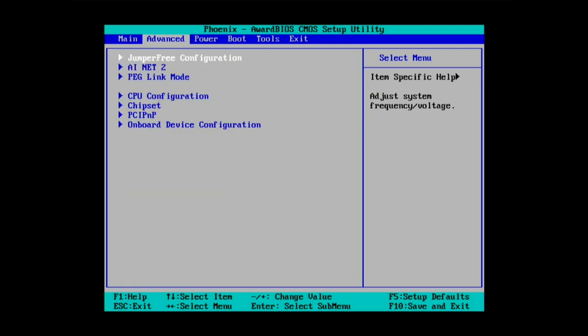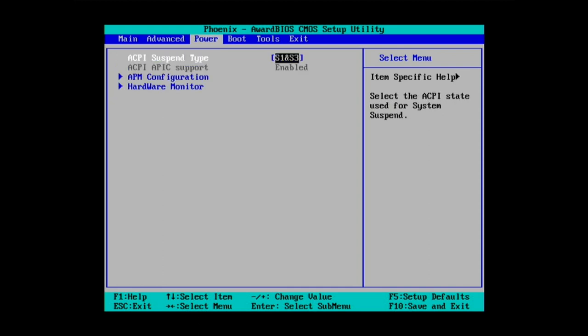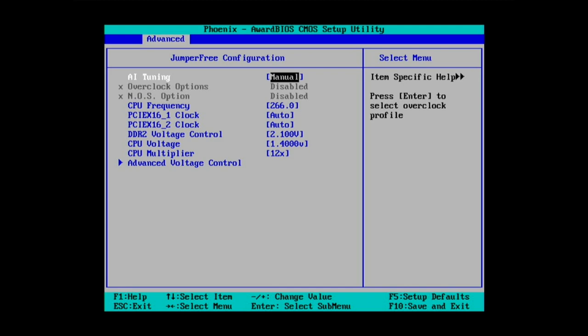And I have had other ASUS motherboards that don't give the voltage you set until they have posted, which means they give default voltage. So if you try to overclock and the CPU was slightly warm, it shut the system down and then started to start again, it wouldn't post, because a warmer CPU is less stable, therefore it needs more voltage. So I have some ASUS board that basically doesn't apply the user set voltage until they posted, which is super annoying too. Because if you shut down an overclocked system that needs more V-core, you have to wait until it cools down to be able to post it again. You can reboot it, but if you try to start it up when it's still warm from the previous power on, it won't work. I had at least one doing that.